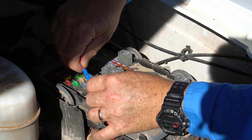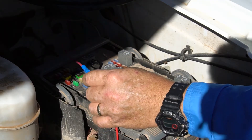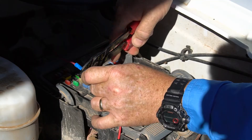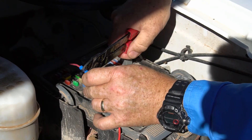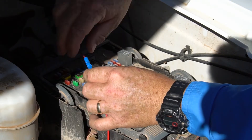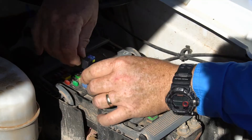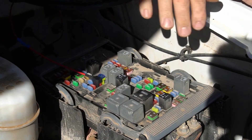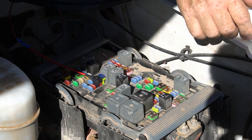It's going to provide a 15-amp fuse service for that outlet. Put both fuses in there and make sure it's well seated. The jumper comes with a connector already installed, so we'll take our wire to the cabin, put it in there, and crimp it down. Always check your crimp and make sure it's solid. I feel a little play on the factory crimp, so I'm going to crimp it again — you can never crimp these things too hard. Make sure there's no play. Now go ahead and replace this into the slot you took it out of, and we've made a connection to the cabin.